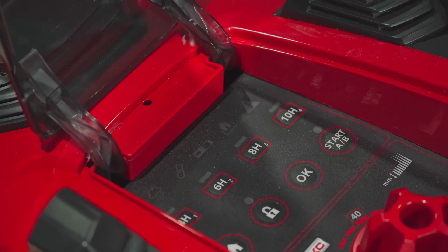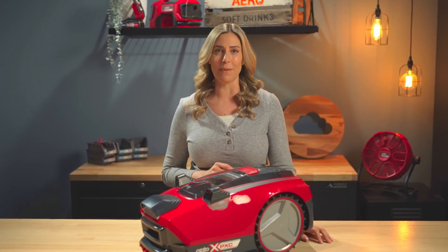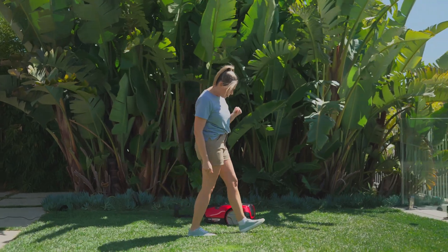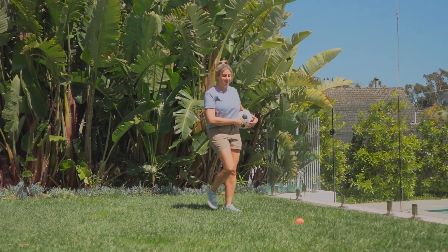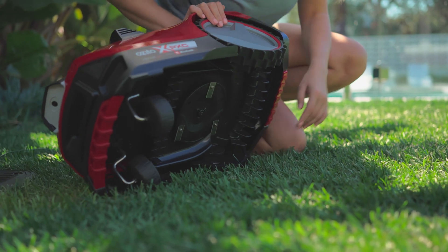And now for the home icon. This one can light up like a Christmas tree, so we're only going to take you through the important lights you need to know about. If the mower is in its charging station and you notice the LED isn't green, take a moment to double check your guide cable — there's a good chance it's come unplugged or has broken. If the home icon is flashing red, it's time to take a tour of your yard and clear any debris and tidy up the perimeter. Then just turn the robot mower over, reset it and send it on its way. If the issue persists or the LED light is consistently red, it's time to dock the robot mower and give our customer service team a call.